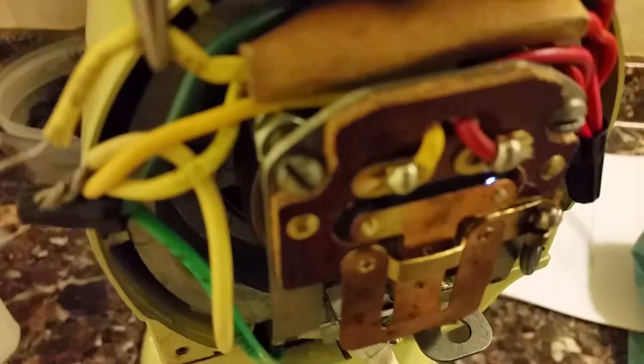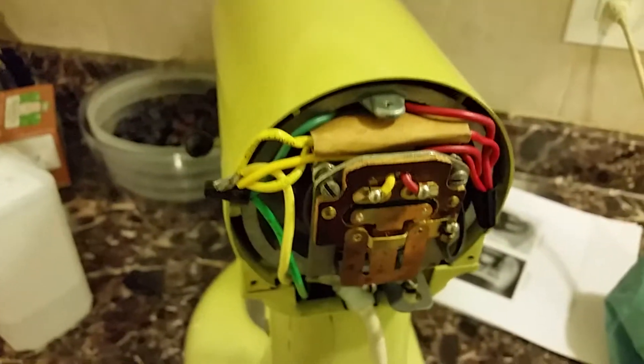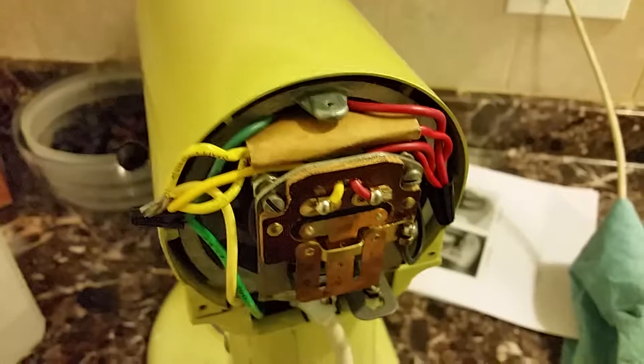More short sparks versus open — no capacitor. With the capacitor, it does the work it's supposed to do. On this model the capacitor is a 0.1 microfarad nominal capacitor, and this one checks out at 0.112, so it's definitely good. That capacitor is important to keep those points from burning themselves out prematurely.